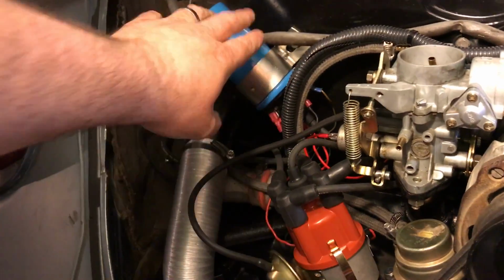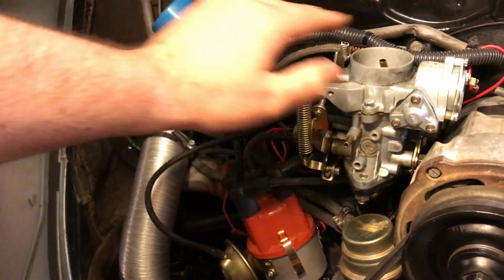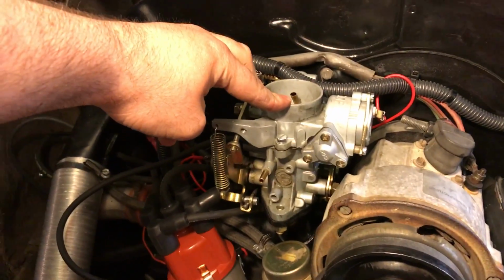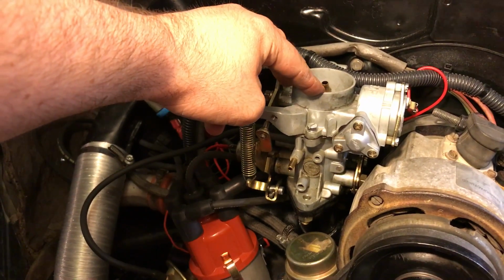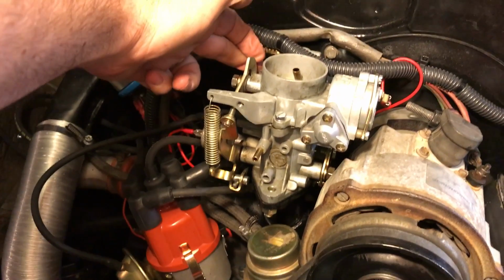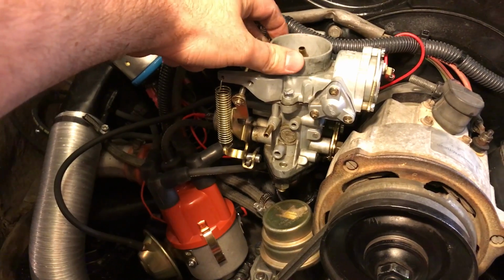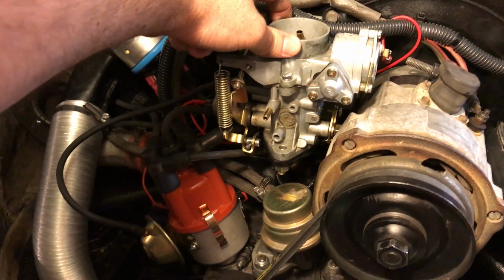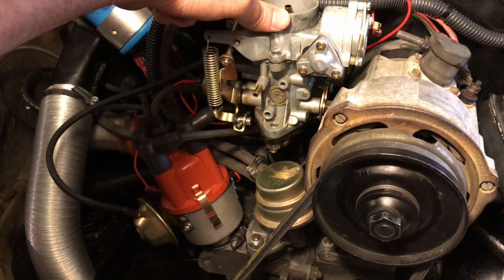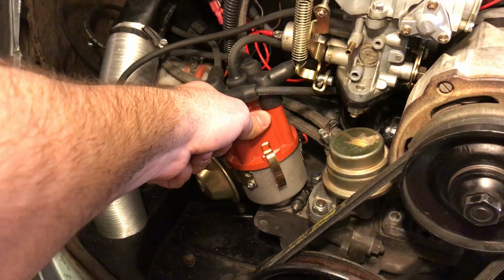Connected there. So everything on that electronic system is new except for the coil, which I had a new one on there and it's been doing the same thing for 4 nights now. Carburetor's been cleaned good. I've sprayed starter fluid down right through the throat with no luck. Fuel bowl I did open up and check, it is full of fuel. Oil's fresh, spark plugs are fresh, spark plug wires are fresh. I've tried adjusting the distributor a few different directions, no luck.